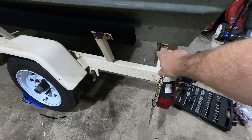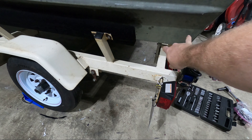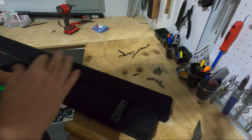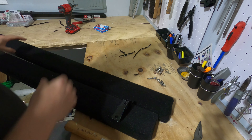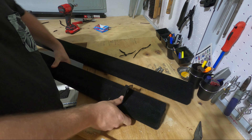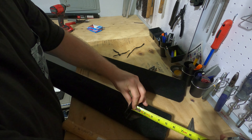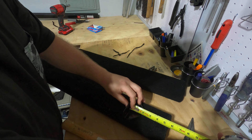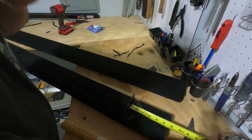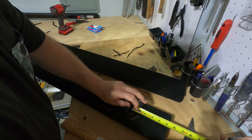Basically, what I'm going to do is measure the distance from the front bracket to the back of the transom, give it about a two-inch lip, and then that'll be where the first bracket mounts. We're going to be about five inches. To put those measurements into context, we need to come in five inches — that's where the flat side of the bracket needs to be. That way, when it's on the trailer and bolts into that front bracket, that's how much overhang we're going to have. Anything over five inches on the inset, we'll just have it hanging off the back more, which is good for the transom, but then you're also losing stability on the front of the boat. So I really want to keep it at about five inches — that gives about an inch overhang so the transom is fully supported.